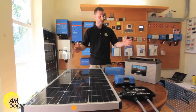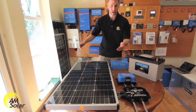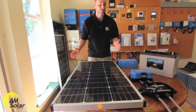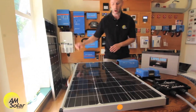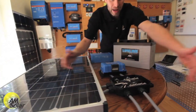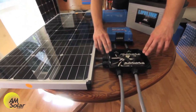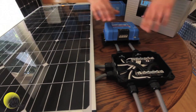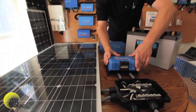So here's the essential parts of the system. We'll start with the solar panel. You can have one panel, you can have 20 panels — however many are going to fit on your vehicle. All of the solar power is going to come into the panels, and however many panels you have, they're all going to feed into a roof combiner box. The roof combiner box is then going to take all the power from the panels and feed it into what's called a charge controller.